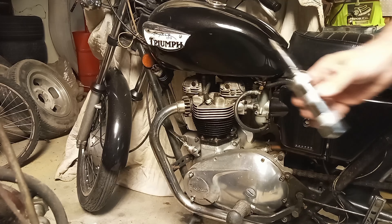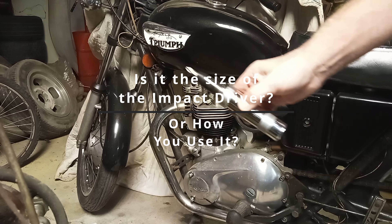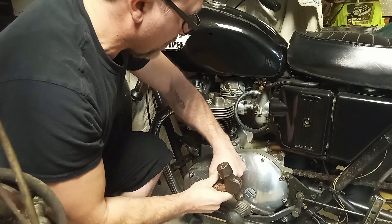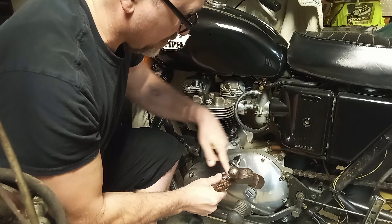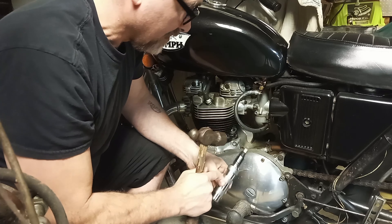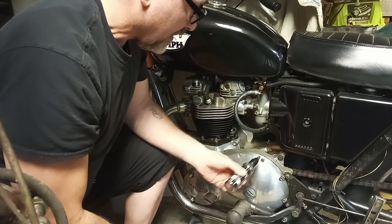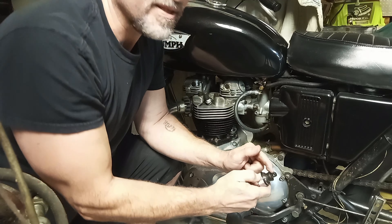And another thing — this is a very handy tool to have — this is called an impact driver. Now this doesn't have to be just for motorcycles and Phillips heads, even though it does work very well for that. You put it up against there and hold it with a little bit of pressure like you're going to turn it. Get a good grip — it's got knurled edges. Then you smack it with the hammer and it won't just drive impact in there, it'll actually turn a slight bit as it impacts. It's just the right amount of timing, the right amount of impact, and it'll break that loose without stripping it out. It works on Allens and on Torx because you can take your Allen bit or your Torx bit and put it right on there. Isn't that neat? I'll put a link to one of these on Amazon in the description.